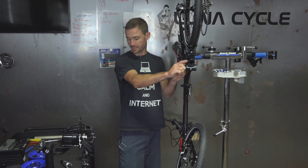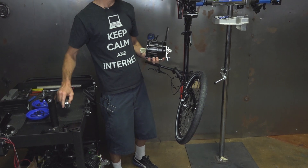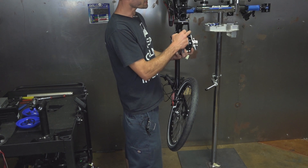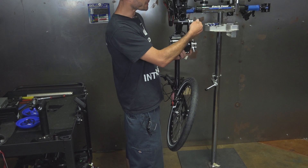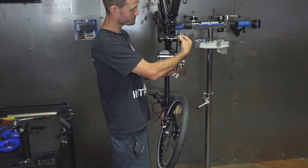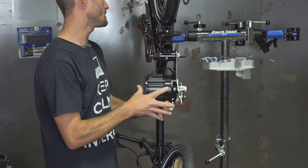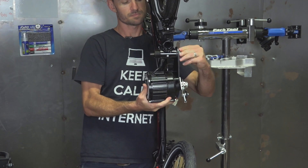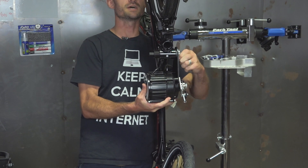Go in maybe halfway for right now, but you'll have to adjust it a little bit. Take your motor and your bottom bracket — the thick bracket goes on the drive side. Get the cartridge through from that side and thread it in. Don't forget this is reverse thread — that helps.